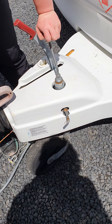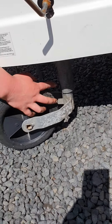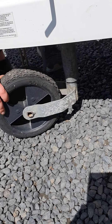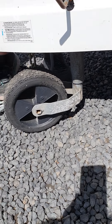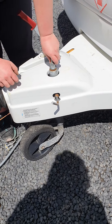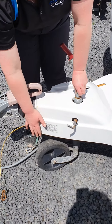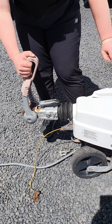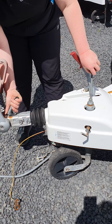Once you've got your tow ball hooked up, there are some grooves down here and the arms of the jockey wheel slide into those grooves, so you can get the wheel up as high as possible. Then undo this lever and pull the whole mechanism up into your A-frame with your wheel facing the back. When you arrive at your destination and go to unhook the van, unwind this, drop your jockey wheel down, put your handbrake on, come to your hitch, pull up that secondary lock, then lift and hold this lever while you use your jockey wheel to wind it off the vehicle.